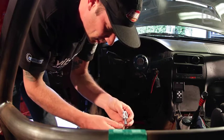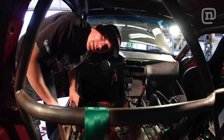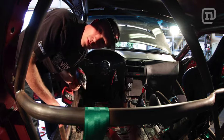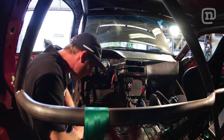So you want to make sure that you don't drill too close to the frame rail when you're punching through the floor so that you can clear this washer on it. But since I don't care about sand that much, I am just going to freehand this and throw a hole through the floor, and hopefully we nail it. Oh man, I'm money. I'm so good at this.